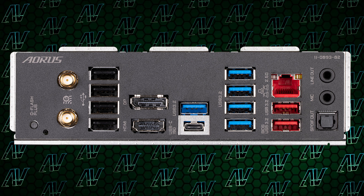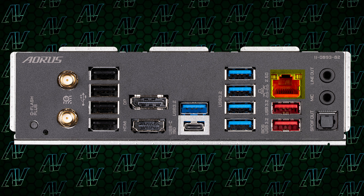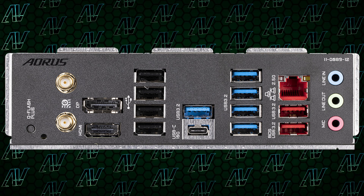In that case, why not just connect some external SSDs — or 11 of them? Gigabyte's over-the-top approach to USB Type-A is still here, with 11 USB Type-A ports in total at the back, with four of them being Gen 2 — the exact same setup as on the ATX Elite. Most of the rear IO is exactly the same: a fast 10 gigabit per second USB Type-C port, both integrated DisplayPort and HDMI, 2.5 gig Ethernet, and Wi-Fi 6E are all here. What's also here is yet another one of Gigabyte's cardinal sins — the lackluster audio options — with once again only three audio jacks. But wait, that's actually an optical S/PDIF, something you don't even have on the ATX variant, where you just have a third 3.5mm audio jack. I'd rather have the full five audio jacks plus optical S/PDIF, which we've been doing for over a decade, but it's still something.